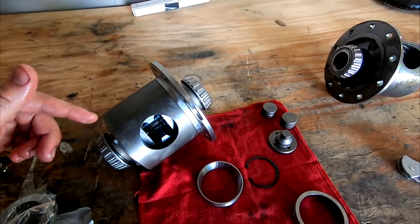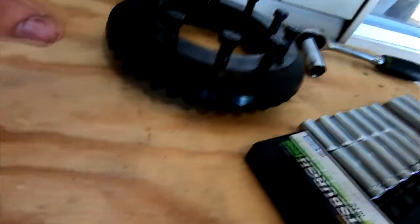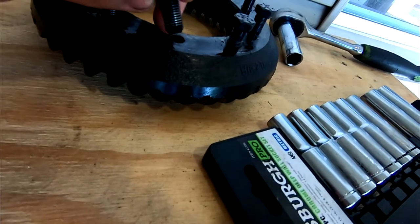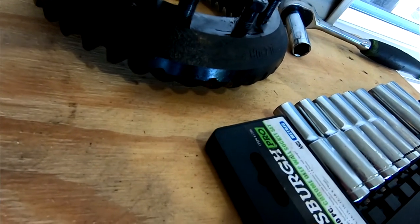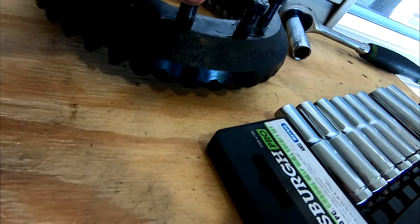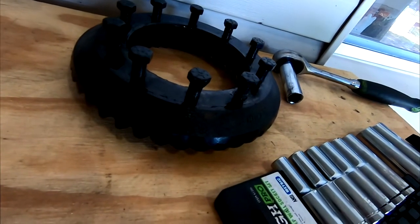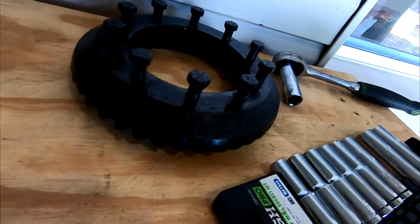Maybe, that may not work. Yeah, it'll work. I'm going to put them all on the top and then we'll just do one at a time. That'll work. One of these is actually really sketchy. It looks like they may have cross-threaded. I believe it's one of these. You can see that shininess on the threads. So I'm a little concerned, that just looks like red Loctite. I'm really concerned that they may have cross-threaded one or two of these. So I want to make sure these go in the exact same holes. So if they are cross-threaded, you know, they still kind of match up.